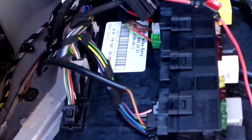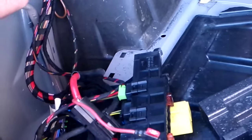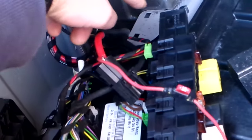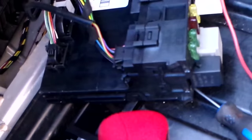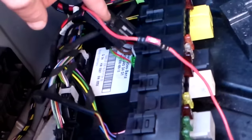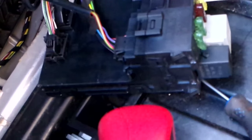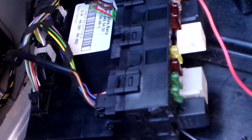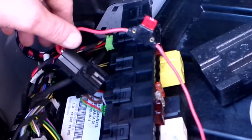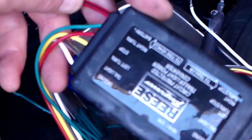So this is the ever terrifying rear SAM module. It just sits here behind the carpet on the driver's side. There's a little metal bracket that holds it in and it simply rotates out of the two little feet on the bottom. I've pulled the power plug — the main power — this goes right to the battery. Unhooked that and tapped a fusible link into the back. Soldered it on — this is directly to the battery and it's going to go directly to the trailer converter.